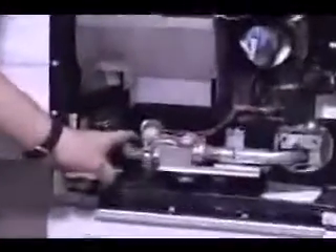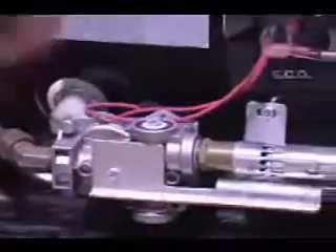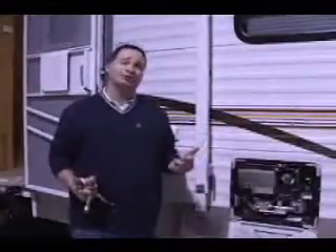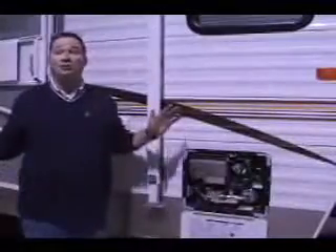My plug is always here on the hot water heater — unless it's a Suburban, in which case it's in the middle. Remember the Suburban takes the larger socket. I take my socket on my ratchet, reach it up in here, put it on the plug, put my ratchet on it, turn the plug, and let it come out. When it starts to come out it's going to bubble and glug because there's no air getting in. At that point I stand back so I don't get soaked, open the pop-off valve, and the water will shoot out. Once that hot water heater is drained, it's done — you don't put antifreeze into it. It wastes six gallons of antifreeze and it could put a taste in your tank. So when that plug is out and it's drained, pop the pop-off back down, you're done. Take your plug, put it back, shut your hot water heater, and it's finished for the winter.